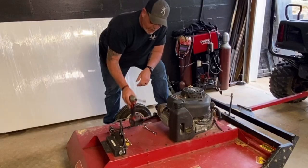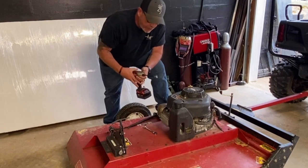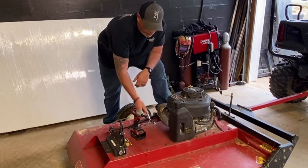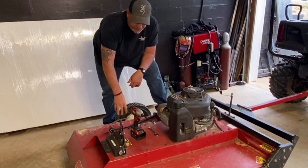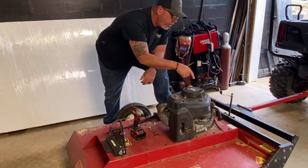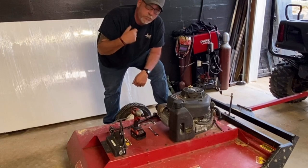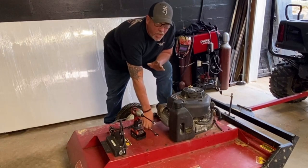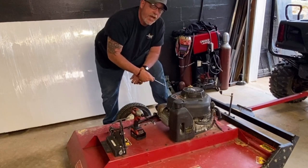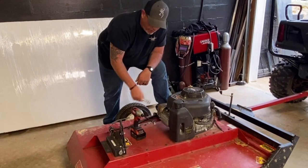Let's get to tearing it up. To get started, I'm going to need a half inch socket on a three-eighths drive and an impact, and a half inch ratchet. There's actually six bolts in this back plate, two in the front plate, and then two at the front of the motor plate. They just come right out — they don't have any nuts or locking nuts. But there's two more on each side that will have to have a wrench once you take it off to set the motor off.